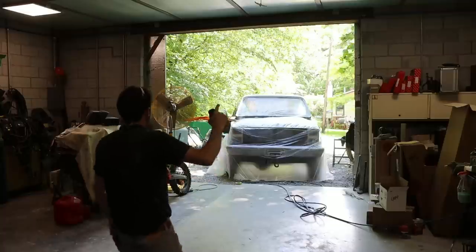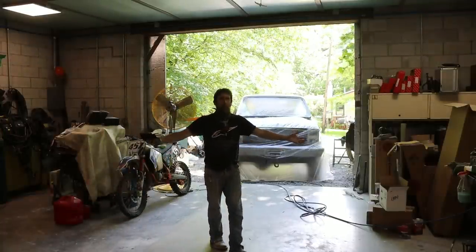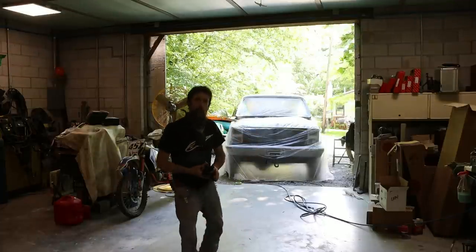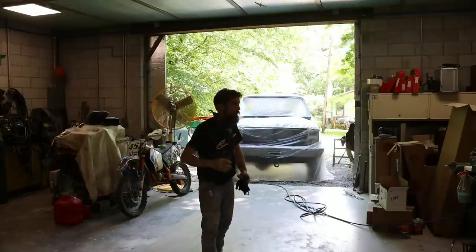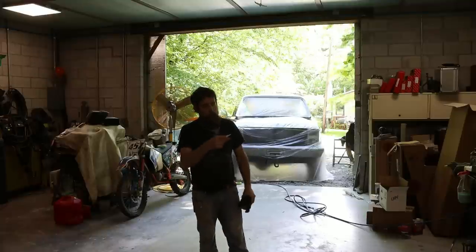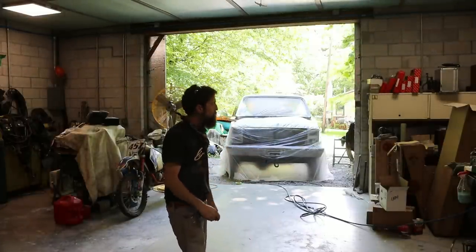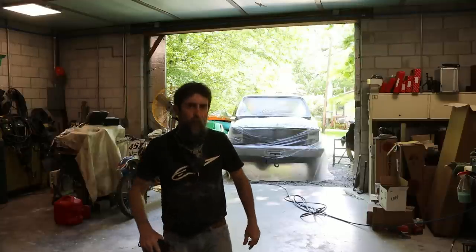well, call him back. So I have spent all day since daylight, actually, since daylight occurred, that's been hours ago, by the way, sanding till my fingers hurt on this cab to get it ready for its hopefully final shot of primer. We're gonna shoot it with some urethane primer. Let me take you out here, show you where we're at, what I've been doing, my plan, then we'll mix up some primer, and then we will hopefully spray it before it gets dark, maybe even the doors. Potentially a hood, I don't know, we'll see. Let me show you where we're at, and we'll get moving.